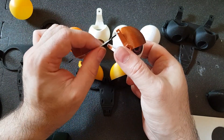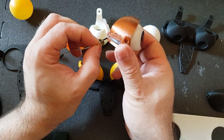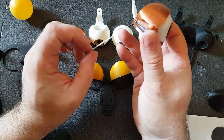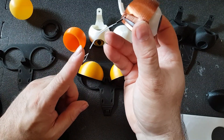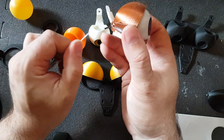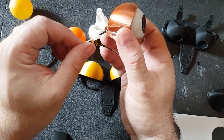The outer layer of the cable should be as close as possible to the minimum position so that you do not have a lot of cable that is unsupported on each side. Because if you start and end the outer cable, for example, like here, all the cable in between would be unsupported and could go any direction — and not move the eyelet. That's not something you want. You want it as close as possible.